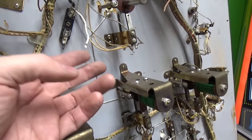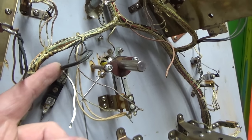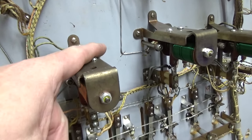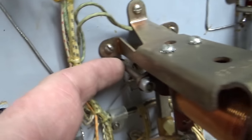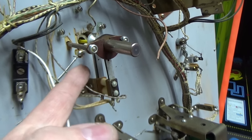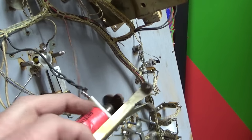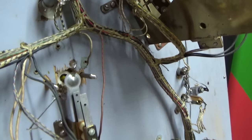I'm going to take these apart, but first I'll re-put the wires on the coil where they go. We figured out on the previous video that a bunch of stuff had been hacked — this black wire should go to one lug on the coil and this other wire should go to the other lug, and then we're good. To remove this from the bottom of the playfield, you need to take three screws out, which removes the bracket. The coil will remain mounted on it, but you need to remove those pieces which will allow the plunger here to stay with the coil. Once you've done that, you take the wiring loose for the light and then pull the whole thing out the top — there are a couple screws on the top.